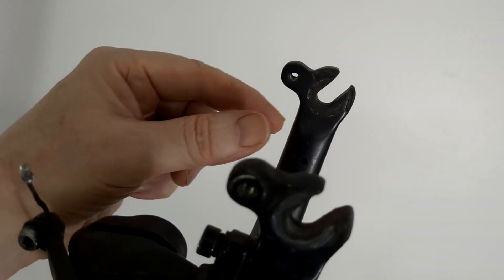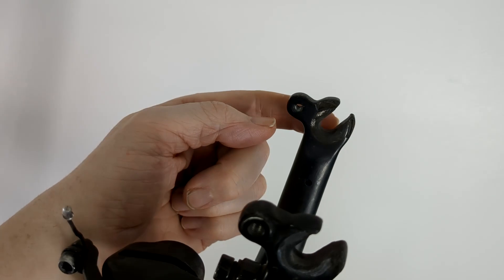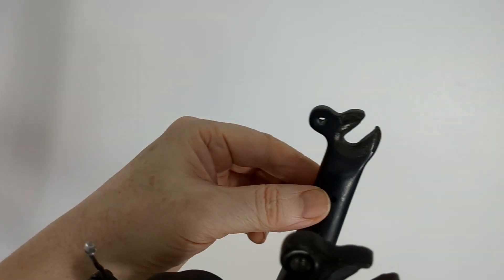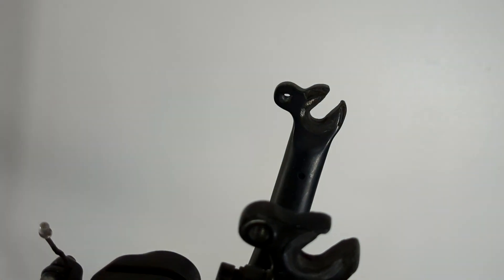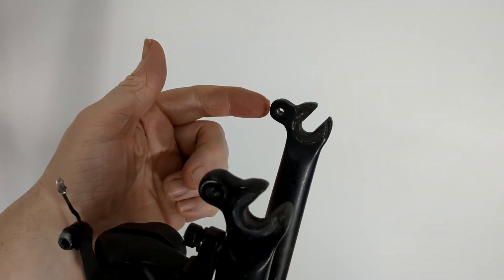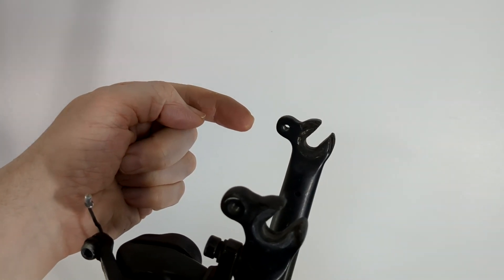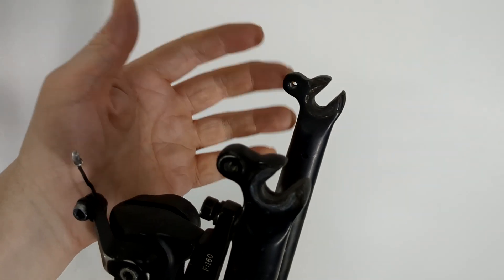Some also suggest a torque arm — it's a sort of fitting that comes out here and then goes back in, held there by a jubilee clip. Your motor takes its torque from this side because the motor cable goes in there. It's to give more support so the dropout doesn't break. I think for 250 watt motors someone said you don't really need them.